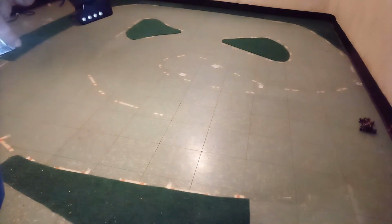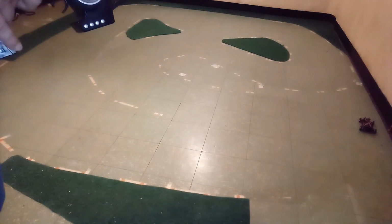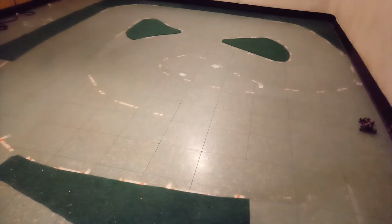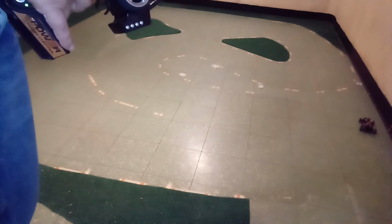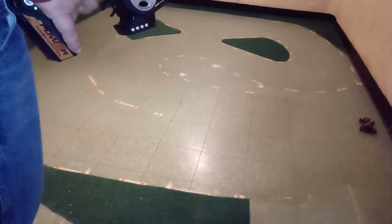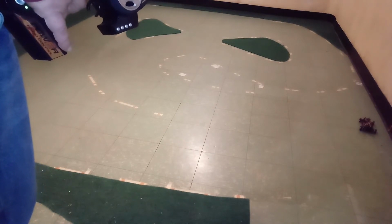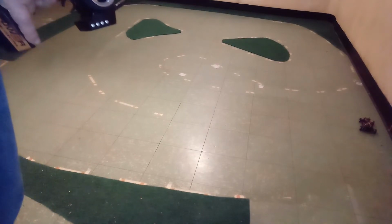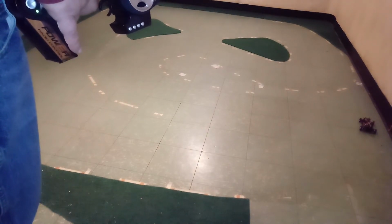So I have my rear differential in there so that it's the stock differential, and it just rolls, you know, as a normal car would. It's a limited slip, you know. One wheel gets traction, the other one doesn't. So it's not fully a drift car per se, because drift cars usually have a locked rear axle, or what they like to call in the business a posi rear end, posi traction, which means both wheels spin at the same rate, which causes the car to fishtail a little bit around the turns. Very old practice, much older than I am even.